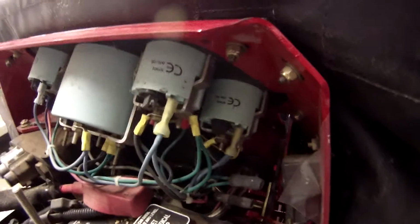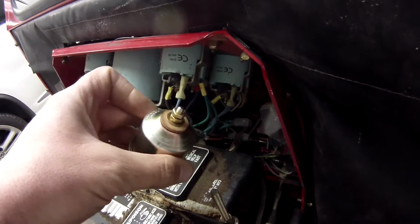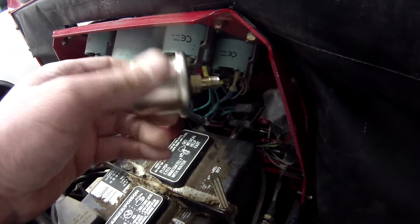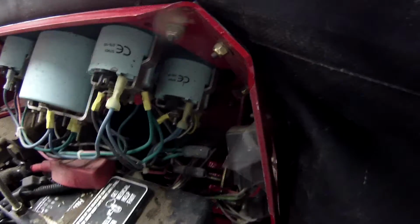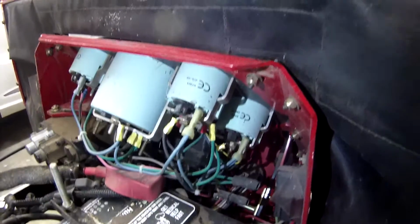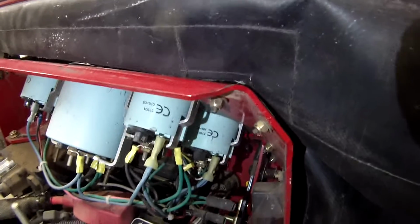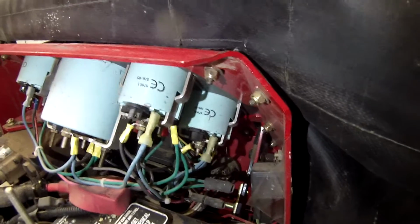I got this through a marina, but you have to get the sending unit with the gauge, whatever one you get. This is, I forget the ohms. I'll write them in below also, but it's a group C for that gauge for the sending unit. I went with the 80 psi unit, not the 100, just because these don't read a whole lot. So make sure you get the 80 one if you do get one. Summit, you can get any kind of gauges, but just make sure you get the proper electronic sending unit to go with the gauge you're specifying.